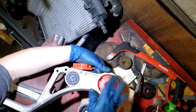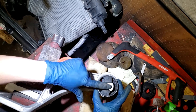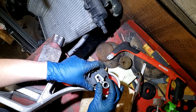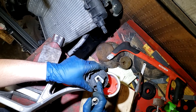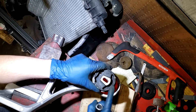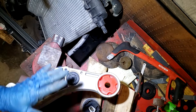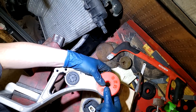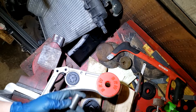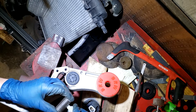There's no direction to it - just center it in there. These bushings are directional where they have a slot, and you want to make sure that slot is oriented toward the front or back of the car. I purposefully used this size of steel tubing so it's a little larger than it needs to be, giving you some room for the bolt to move so you can center it - just like you can with this mount. This is a steel sleeve so it's stronger than aluminum. Press one bushing half in completely seated, then the other, and put a little bit of grease on the steel pin so it's easier to get in and out.